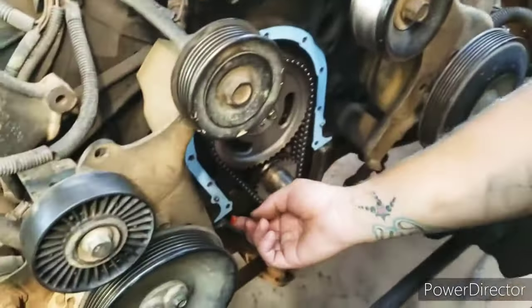These hoses here, I couldn't get the exact ones. So, if you can't find a hose you need exactly, what you can do is go into your auto parts store and just say, hey, can I look through your hoses and find something that I can cut up? Because this one is about good. And it's a little off there, but I think it can move around. I mean, it's not terribly off. Do a little trimming, and this hose will probably work for that one.